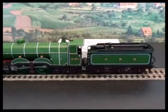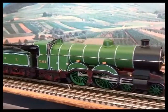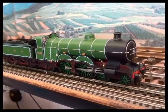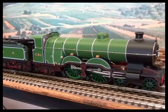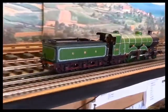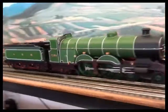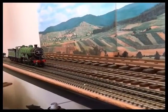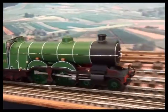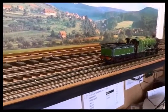We'll put it on the main track now. This loco is typical of many of the Bachmann Branchline steam locos that people will encounter. On the factory settings of the decoder it should run beautifully smoothly, even down to a slow speed. I haven't set up any inertia figures, so this is all just on factory settings. You can program in acceleration inertia on CV3, braking inertia on CV4, and you can reduce the maximum speed of the loco on CV5. There are many more things you can do if you wish to.